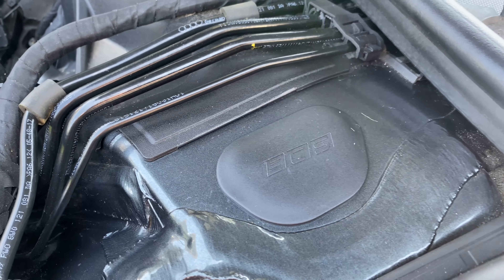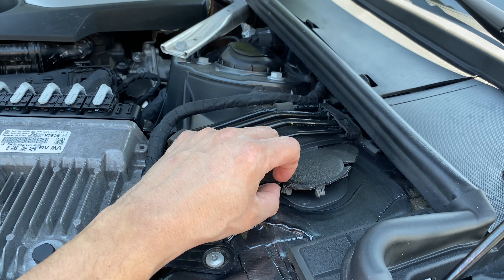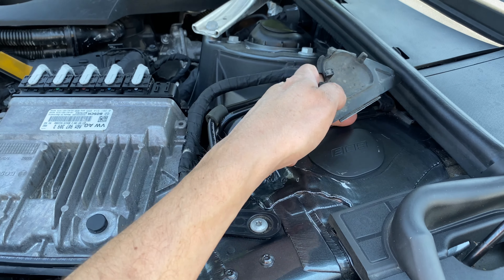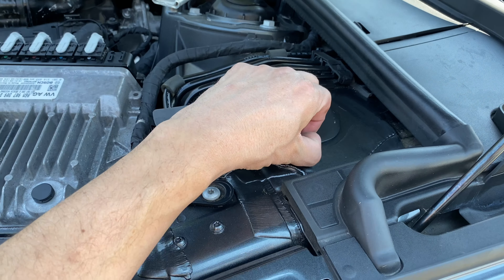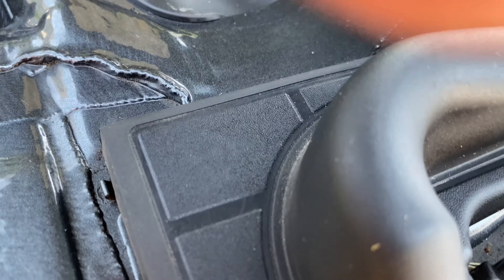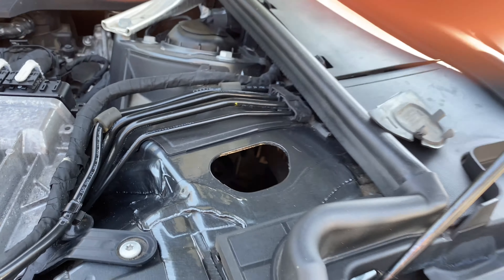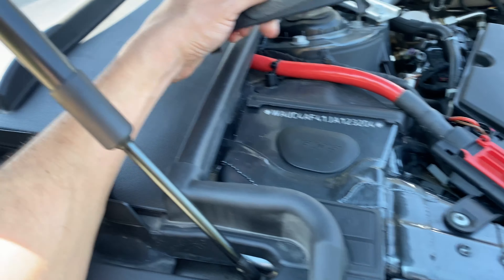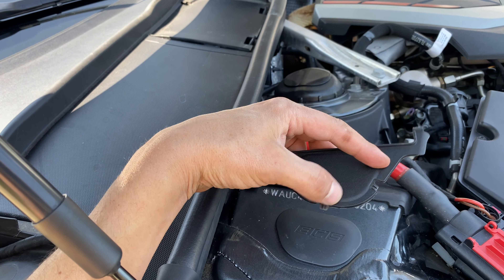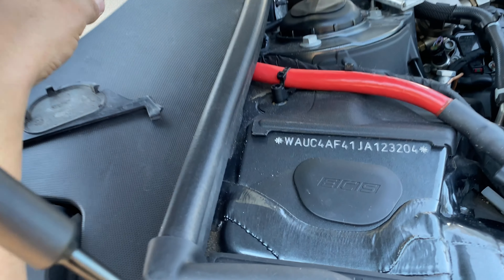These are called strut tower hole covers. Stock comes with this piece — it's like attached to a flap and it's snapped in, so you just unsnap it and bend it back and forth. I also used a razor blade knife edge to get that smooth. This is just a grommet here — you can actually reach under the wheel well and get to the hole. I just popped it out. The other side has a slightly different flap, but these little holes leave gaps where water and air can get in and it's not sealed well, so you just bend it back and forth or cut it, and then pop this in.